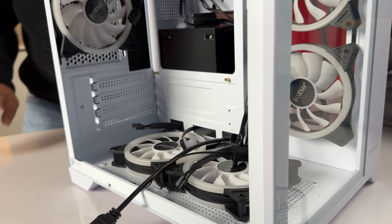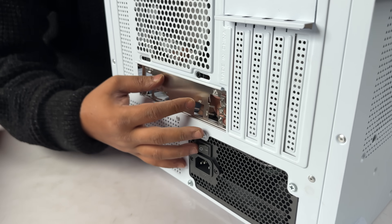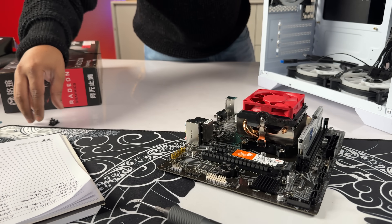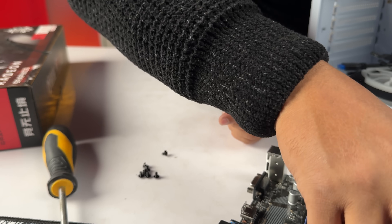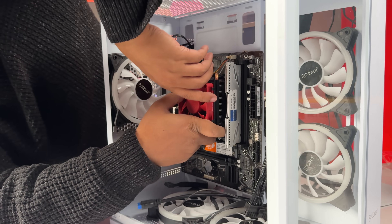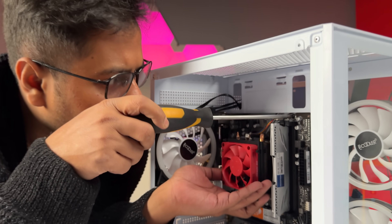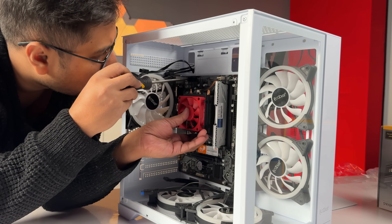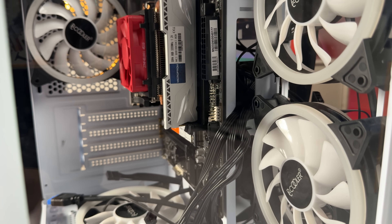This is the motherboard mount — it is the same as a standard motherboard mount. Mounting the motherboard is usually the most painful part. You need a long handle screwdriver to align the I/O shield and mount the board. Stand-offs must be properly aligned. Stand-off count is 4, and main screws are 6.